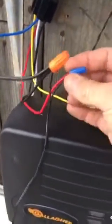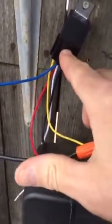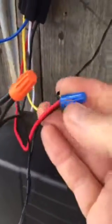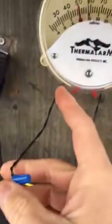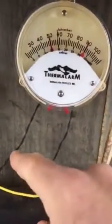The positive side of the output wire is connected via this red cable to terminal number 30 on the relay — this is the incoming constant 12-volt supply. The positive side of the transformer output is also connected to one of the two leads going to the thermal arm. It doesn't matter which lead, as this is just a switch and direction of flow doesn't matter.